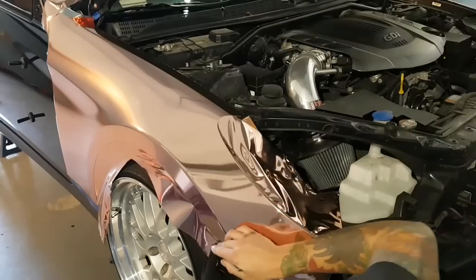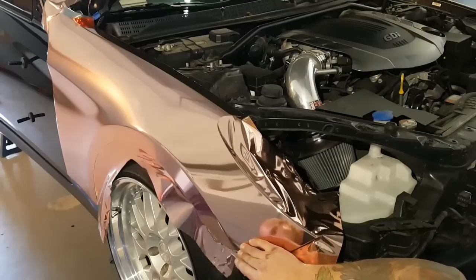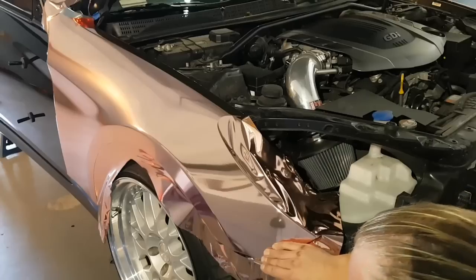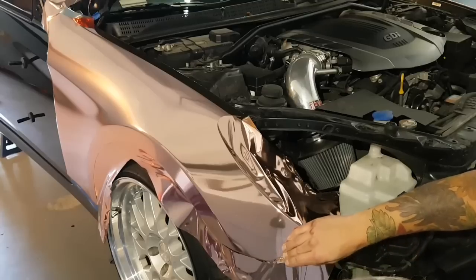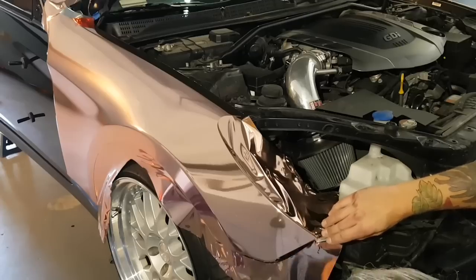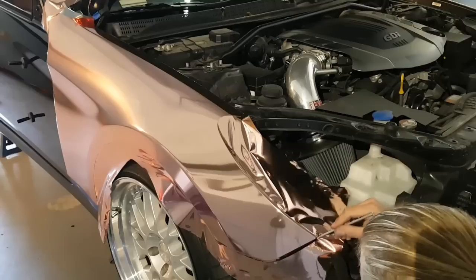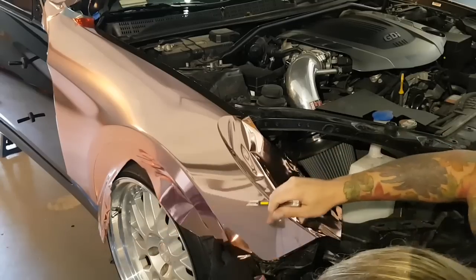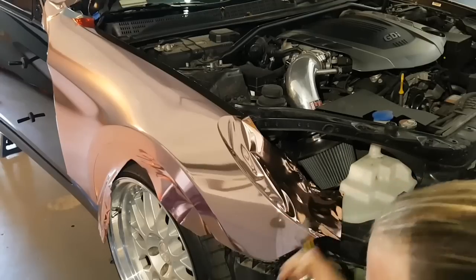I'm going to trim off the excess on the bottom. I'm leaving 1/8 of an inch. I'm not cutting on the paint. I'm just adding tension to the bottom here and using my finger as a guide on the edge. Knife work takes a lot of practice, so you'll get comfortable with that eventually. I want to make sure we're good, and we're good. We look good. So, again, I got rid of this piece over here, cutting down and away from that corner. That way I have a little bit of excess to play around with this bottom corner over here.